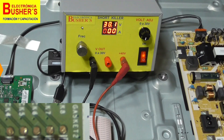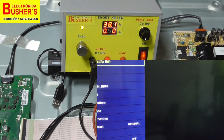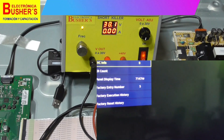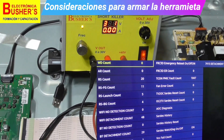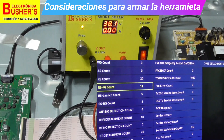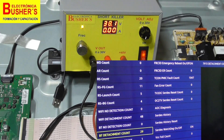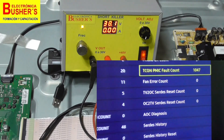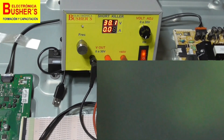After this action, it's important to enter service mode and clear the errors. So we enter service mode — info factory, SVC, info error code — and clear the error to stop the TV from turning off, since the PMIC counter always maxes out. Here we are in service mode looking at the error counters, and we see the counter is at 1047, meaning it was extremely high due to multiple shutdowns. We reset it.